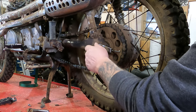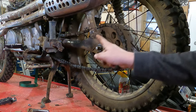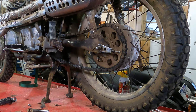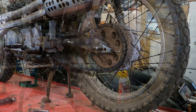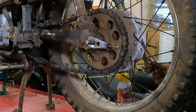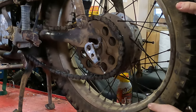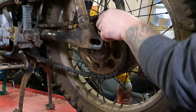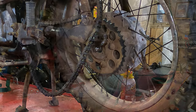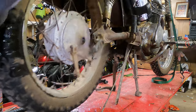Luckily, I didn't have to do that. When we take this apart, we're going to be very careful to keep track of the order — it's going to be a nut, a washer, axle adjuster, spacer, spacer on the other side, axle adjuster. It all has to go back in the same order it came off. It doesn't even hurt to take a lot of pictures. Take the washer off, then put a screwdriver through the hole in the axle on the other side and walk it off. Pull the axle adjuster off, pull the chain off — you're going to get greasy. Pull the spacer out and keep all that in order. Then lift the wheel a little with your left hand, grab the axle with the right hand, and pull it all the way out.